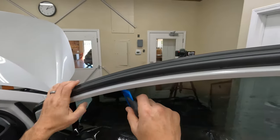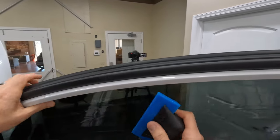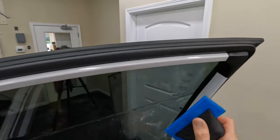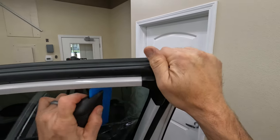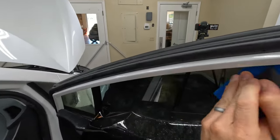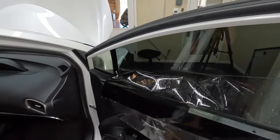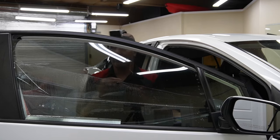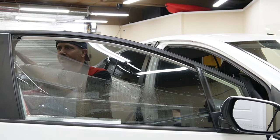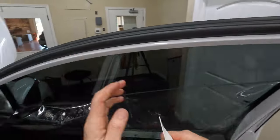If it does move around, I'm going to be able to feel it. Doing basically the same thing without the edge to hold on to. But at this point, if you're not running too soapy, it should just stay stuck. I'm getting nice good squeegees out here, and I'm stopping about an inch short of the edge. That's so we can push this water up and out instead of pushing it over, catching dirt, and then coming back down and getting all in this line here — just helps minimize that.